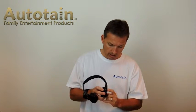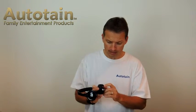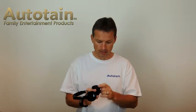Now the next button has an up, a down, and an in. It looks like a volume button. Pushing it in once will pause the music; pushing it in again will play the music if it's paused. If you hold the button up, that'll turn the volume up. If you hold it down, that'll turn the volume down. You can also control the volume with your smart device — I like to keep the volume high on the unit and control it lower with my smartphone. A common mistake is tapping it up, thinking that turns the volume up. If you tap it up and let go, it actually advances to the next song. Tap it down and it goes back to the previous song. You've got to hold it to control volume and tap it to advance or go backwards.